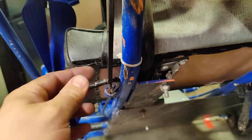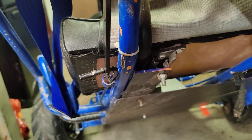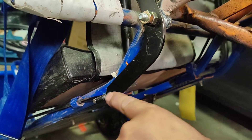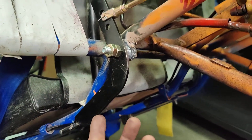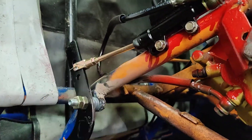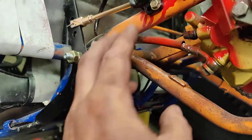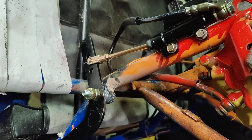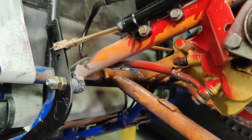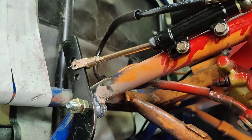It keeps the right space and allows the full movement when the person is pushing the pedal down. When the pedal gets pushed in, this bar goes that way, and this lever goes up, pushing it straight back. The reason I went with this design is because it needs to be very sturdy — if it has any wiggle to it, it just won't work, and the compression that the master cylinder needs just isn't there.